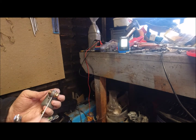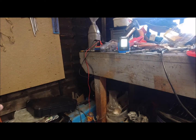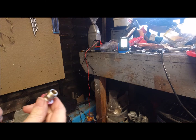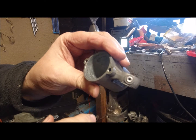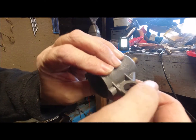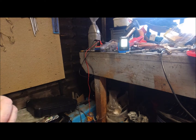Actually, we will. Let's take off the two washers off of here, well, one of them anyway. They're quite tight washers because they're obviously sealing against the petrol. You can also see in this nut where the petrol comes through. I'll just put that washer back, and there's our hole. Again, put your mouth over here, seal it. That's crystal clear. There's nothing coming through the bottom as well.